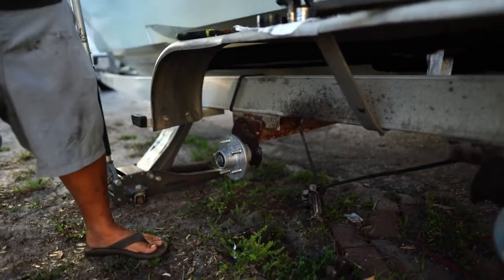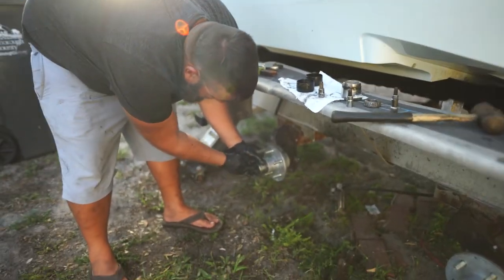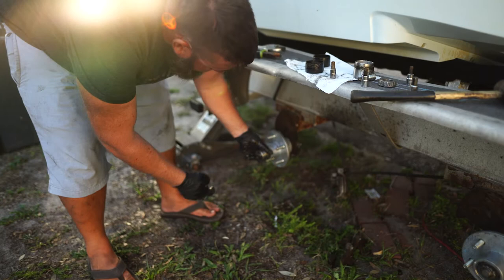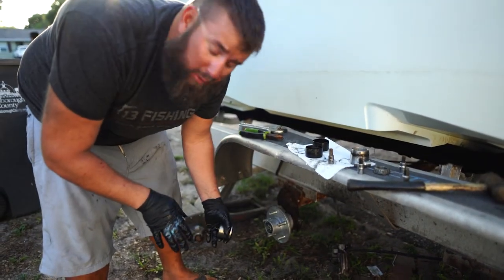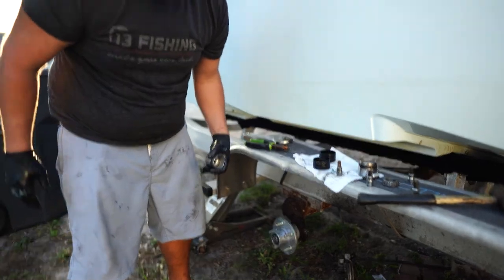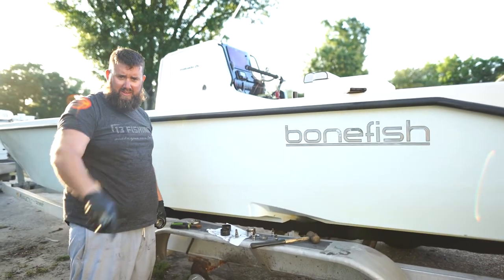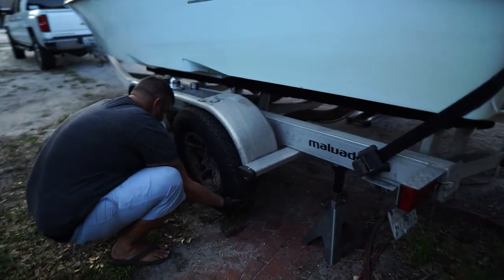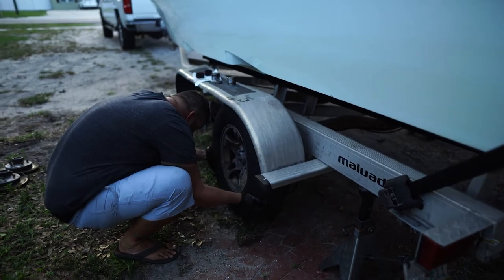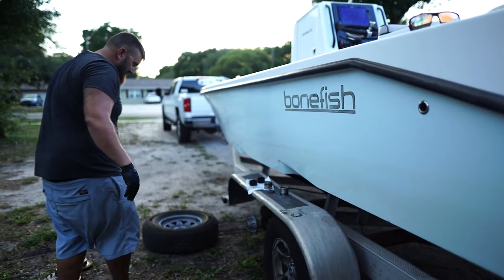There is one final step — we're going to hammer the buddy bearing back on, and then pump this full of grease until it gets full. That's going to ensure that your whole entire hub has an adequate amount of grease so you can go down the road and get back and forth to the boat ramp. Now we're going to get the tires put back on. Remember I rotated them, so everything should be good there.